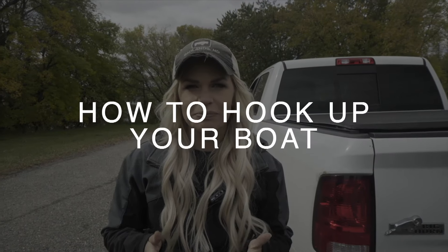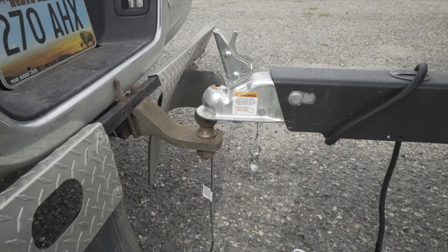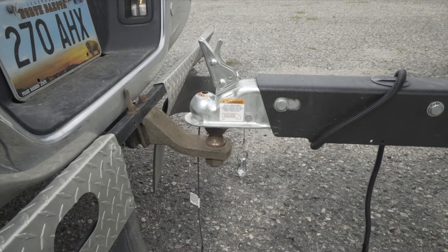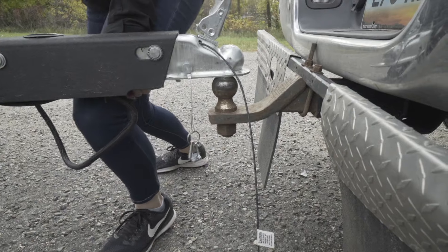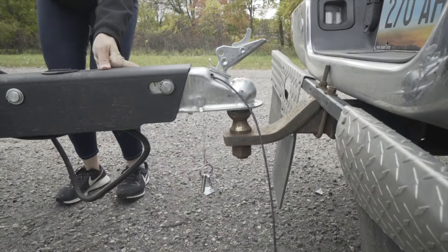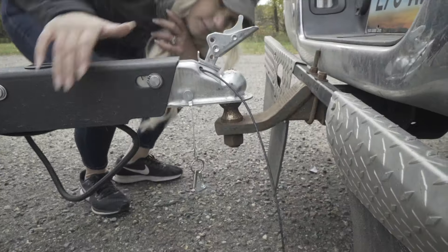The first thing you need to do is make sure that your truck is backed up enough to attach it to the hitch. I like to get as close as possible — I have a backup camera so it makes it really simple. If you don't have a backup camera it's going to take a little practice, but get as close as you can. You're going to have a little wiggle room with the jack. Almost every boat has a jack on wheels, and that's going to give you a chance to move it that hair you need to while you put down the boat hitch. When you crank down the boat you're going to hear kind of a little catch sound.